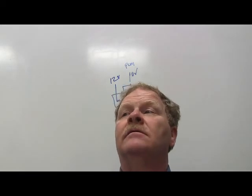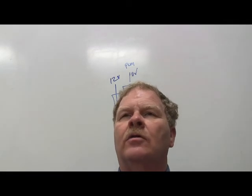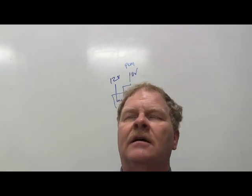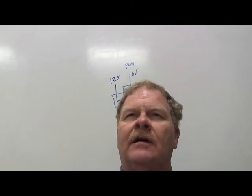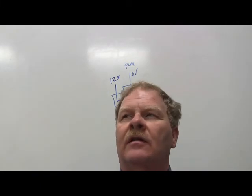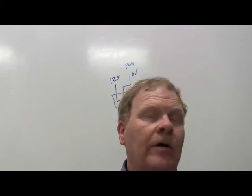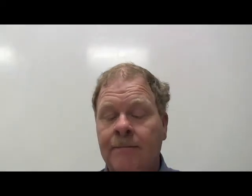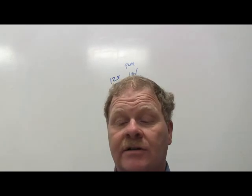It's going to get shorted out. And if it's coming and going, open and closed loop fuel control is paying attention to that signal, and if that wire is bumping against ground every now and then, the voltage the oxygen sensor is creating is being shunted to ground before it ever makes it to the computer, then you're not going to have an accurate reporting of what your exhaust stream looks like. As far as the false rich code, if it's shorted to voltage, it'll cause that.